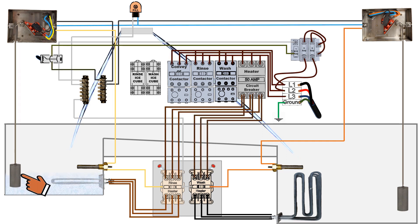As the rinse tank starts to fill, the water displacement weight releases pressure from the lever and allows the micro switch to return to its normal position. This now transfers current from the blue wire to the fill solenoid, to the yellow wire that now goes down to activate the thermostat.